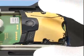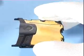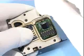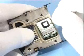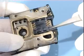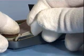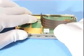Remove acoustic chamber containing camera module and SIM connector. To demount the camera module, take also the SRT6. Also, the SIM connector can be easily taken away. For dismantling the rest of the unit, you first have to unlock the chassis from the A cover.